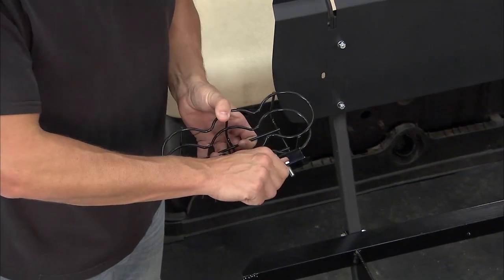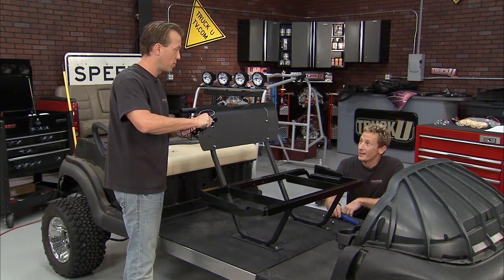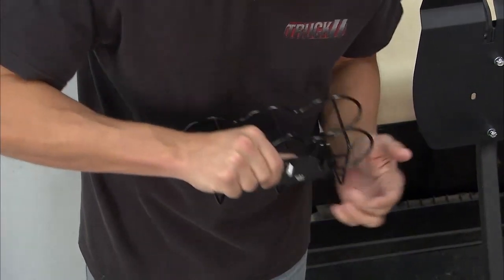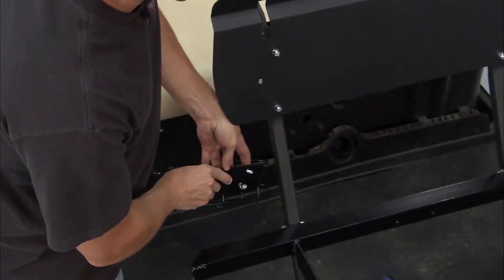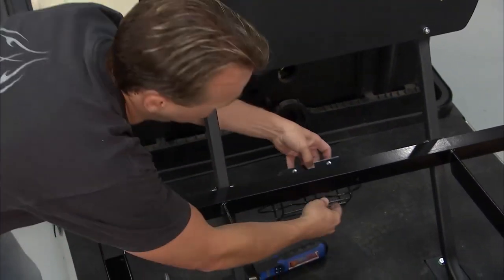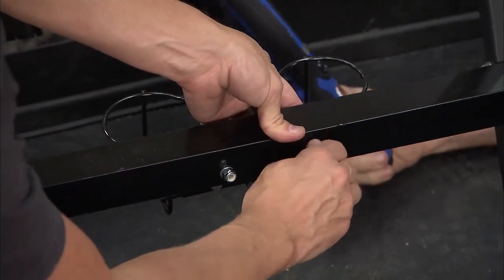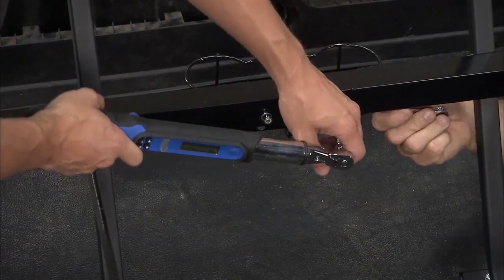And this right here. Did you say torque spec for the beverage holder? Absolutely. There's torque. It's a very important part. You just made that up. No, I did not, because these down here need to be torqued to 9 foot-pounds, and these right here, where it mounts on the rack, need to be torqued to 5. Do you think I would make that up? No, never. Absolutely not, because this is a very important part. You don't want to lose or spill a beverage when you're driving around and doing whatever it is that we might be doing in this when we're done.